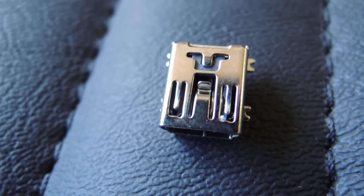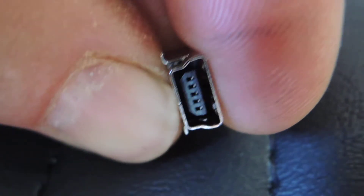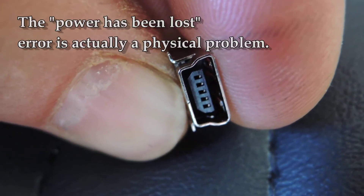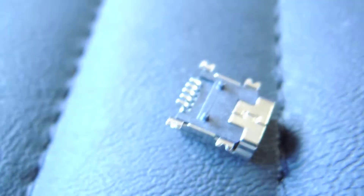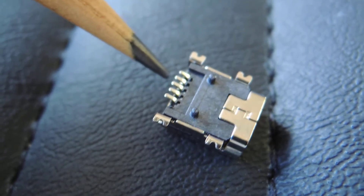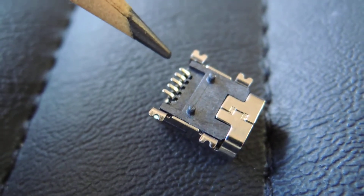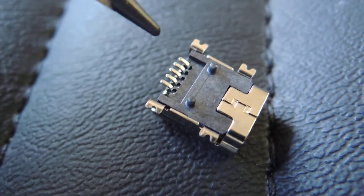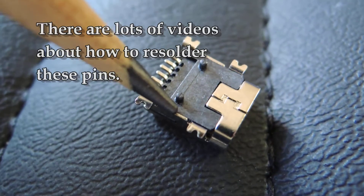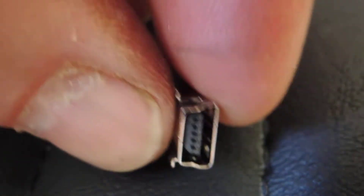I had that scheme and it worked fine for four or five years until recently. Here's an extreme close-up of a mini USB port — this is what it looks like unsoldered onto a board. The power problems where it says 'power has been lost' are related to a physical problem with these ports. Basically, this port is soldered onto a circuit card inside the Garmin unit, and the solder joints associated with each pin in the USB port can come loose or break off. It's not well made for motorcycle use.